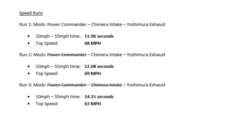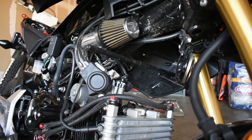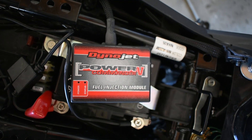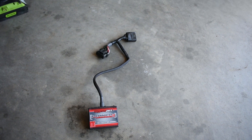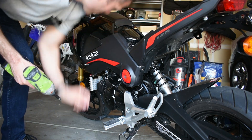So what does it all mean? If the third speed run is our baseline, then an additional $145 purchasing the Chimera Intake yields a 2-second faster 10-to-55 mph run, which is a 15% increase, and 6 mph more top speed. Another cool byproduct of the Chimera Intake is the added throatiness in the revs, especially at full throttle. Interestingly, the Power Commander 5 at approximately $340 showed zero improvement on the speed run when removed from the bike. The bike seemingly pulls a little harder when installed and makes a little more engine noise at full throttle, but we are just talking about performance, and our evidence yields no increase for the money spent.